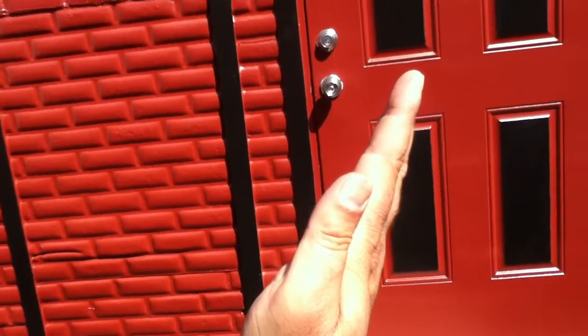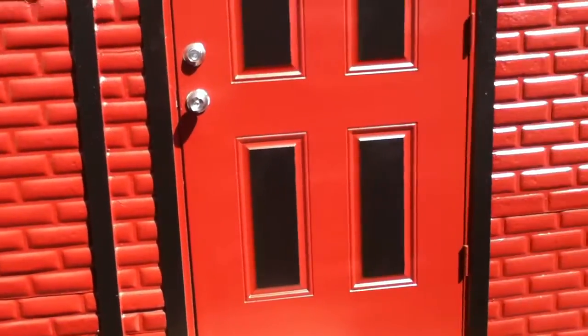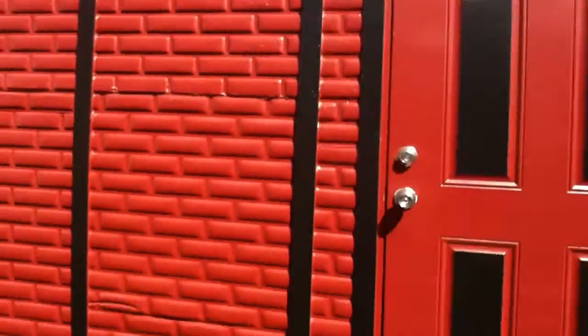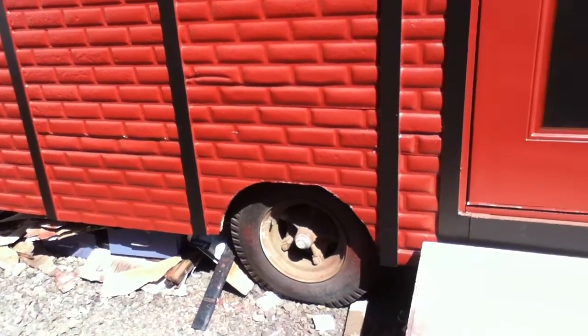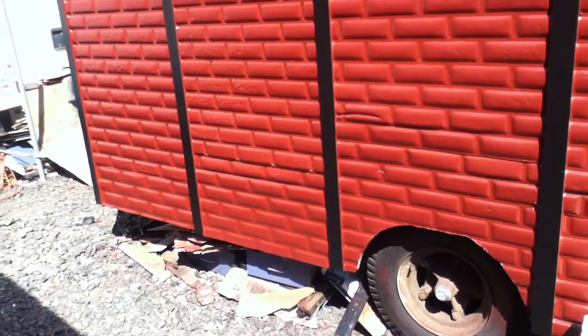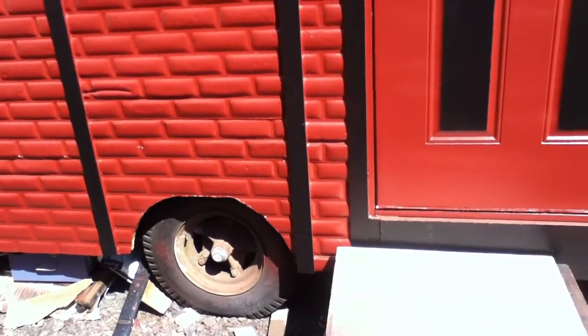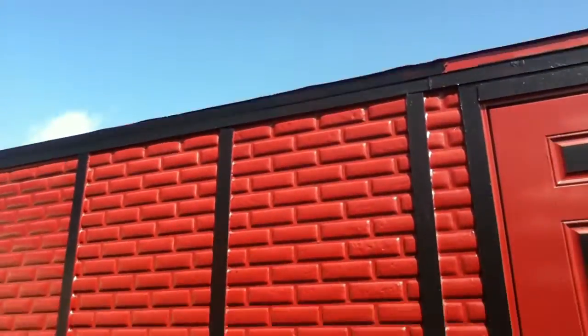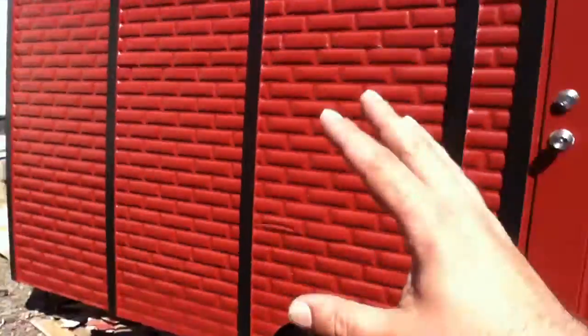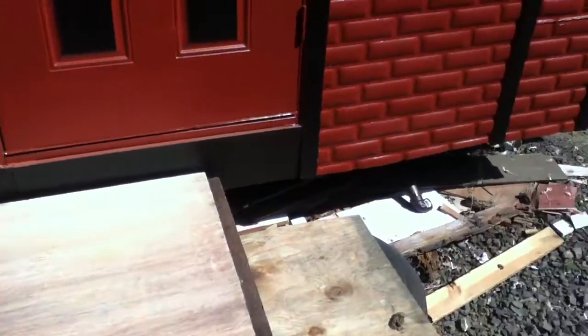Every time it rocks the other way, it can really press down on the suspension of the towing vehicle. So if we have a bunch of stuff on the roof — we actually put water tanks on the roof of these things, they have running water inside — that can really become an issue. That's one of the things to look out for especially in Tumbleweed Townhouses, because they get top-heavy in a lot of designs. They'll build up at the rear with the loft story up there, and the axles are down below, so the thing may not balance well for going down the road.